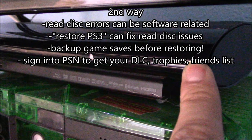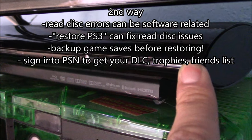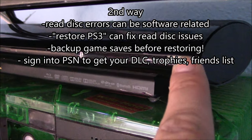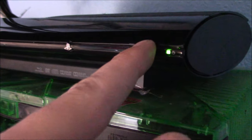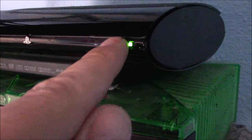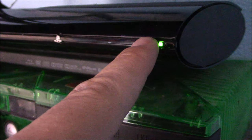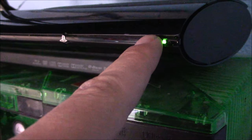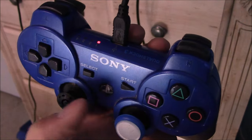To enter service mode, hold down the power button until you hear two quick beeps. The one beep indicates resetting the HDMI video settings, and then the two quick beeps is the service menu. It turns off — don't worry, that's part of the method. Hold the power button down again, wait for that one beep, and then the two quick beeps puts it into service mode.